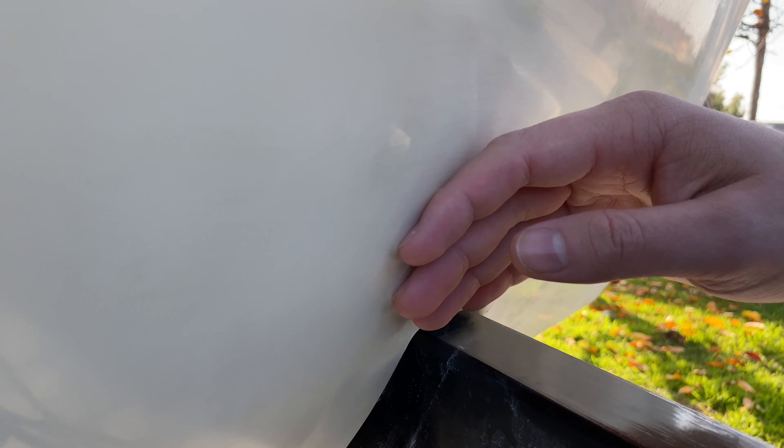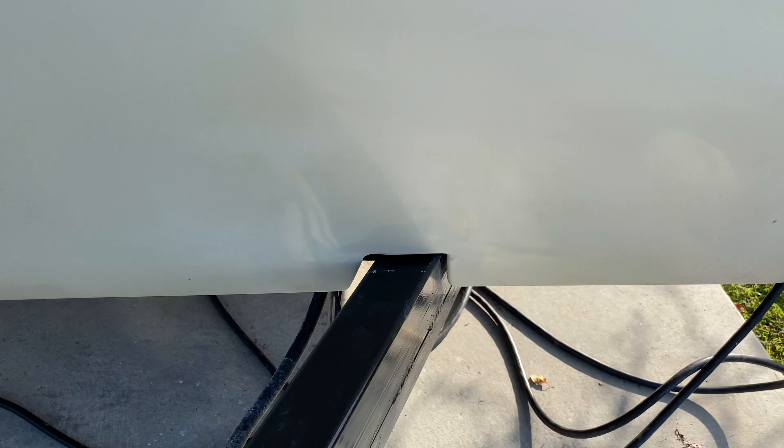Better than it was before. I still kind of see the blotchiness of where it was because the color matching isn't perfect - I had put too much blue tint when I was doing the color matching, so you can see it's a different shade. But it's silky smooth, it's repaired, it's not open like it was before. There are still a lot of spider cracks on the gel coat, but maybe when I have more time and the weather is better I'll probably do it again and hopefully get the color matching just right. I was fighting the sunset and running out of light and couldn't really see. From a distance it's not too bad - it gave me a good opportunity to practice in an area where the propane cover is going to cover pretty much most of it.